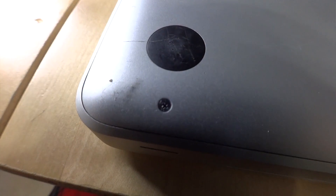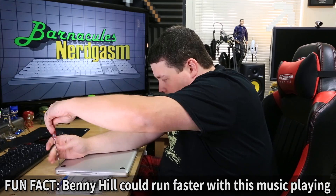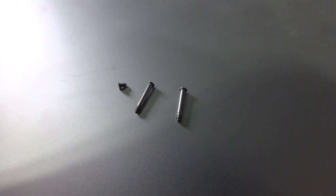The back here is held on by a series of screws — it looks like there's about 8, 9, 10 screws holding the back plate on, so we need to remove those. Once all the screws are removed, make sure you put them in a safe place because they are quite tiny. Also, I want to make a quick note that three of the screws are very long screws. If you have the laptop upside down and facing towards you, those long screws go into the back upper right corner. Don't forget that — it's important.